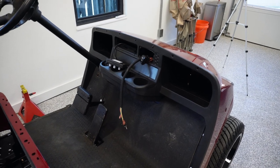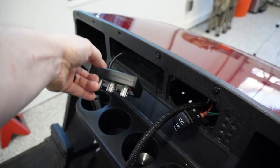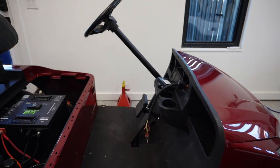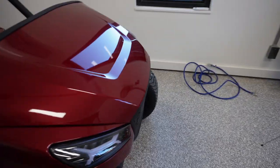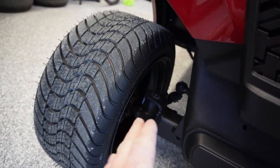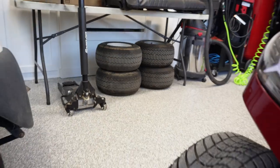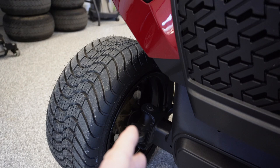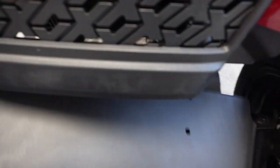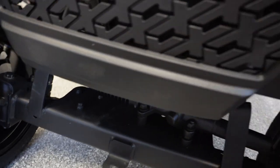Got the instrument panel in, wires ran up here for our forward and reverse, and we got our on-the-fly controller done - in place, not fully buttoned up yet. We still have to run and mount it officially. One thing I really wanted you all to see is I replaced the bushings in here because there was so much slop - I was wearing the tires out. You can see the original tires sitting over there, all worn out on one side. These were completely shot. This shock cover is just temporarily sitting there; I replaced the boot that was all dry-rotted.